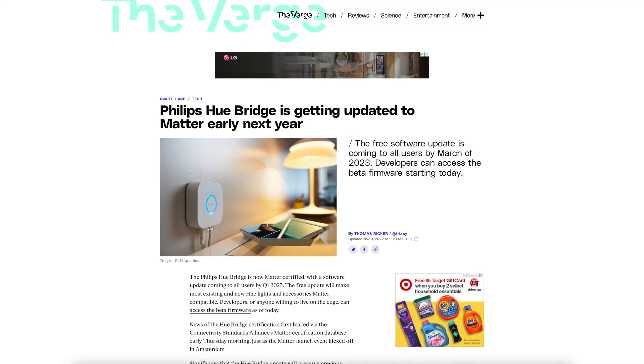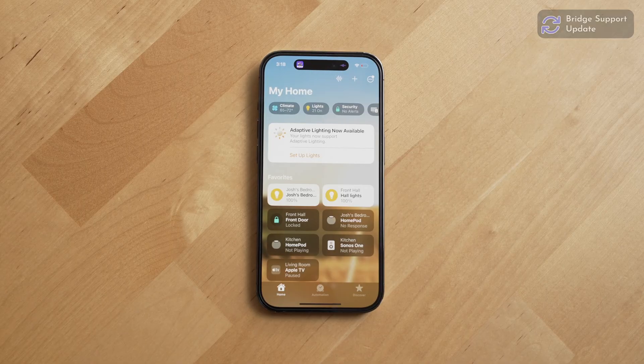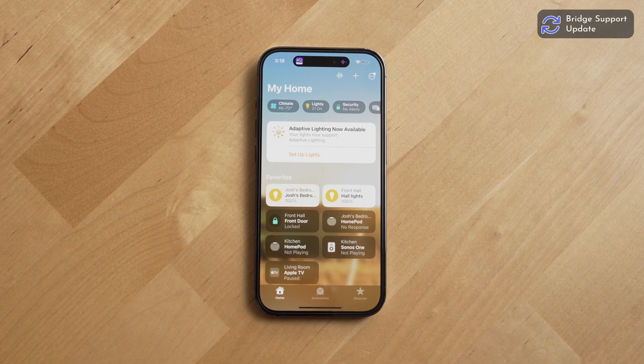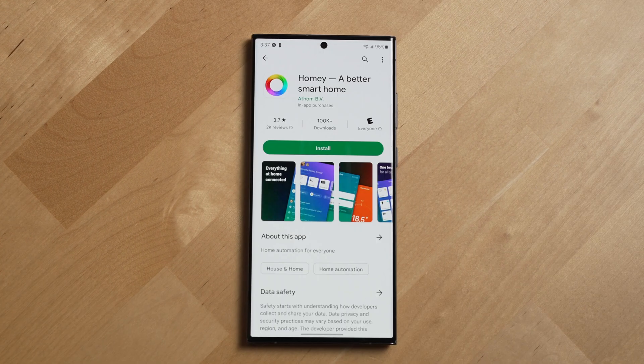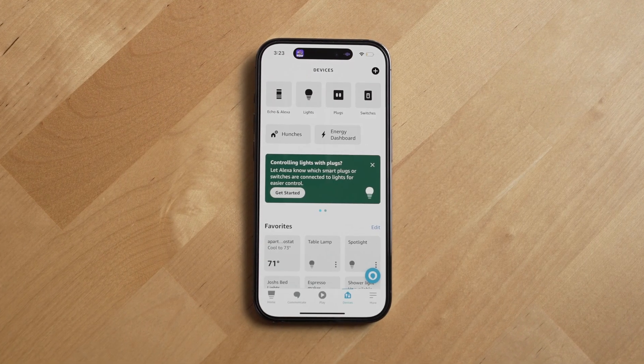What about all the smart home devices you may already have in your home today — will they be able to be upgraded to Matter? Some of these devices might be able to be upgraded to Matter if they have either Thread or Wi-Fi built in. Even some Zigbee hubs will get Matter support, like the Philips Hue and Aqara hubs, via an over-the-air software update. But here's the tricky and slightly confusing part: even if you have a bridge in your home that is updated to support Matter, the device serving as your Matter controller also needs to get what's called bridge support. At the time of recording, only Apple Home supports Matter bridges, with the other smart home platforms confirming support for bridges will roll out later in 2023. So unfortunately, with Matter, it's not as simple as seeing the Matter logo on a smart home device box, buying it, and having that device seamlessly work with all of the major smart home platforms. Yet.